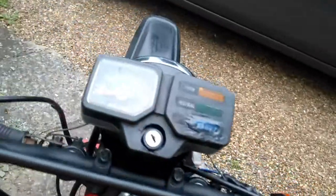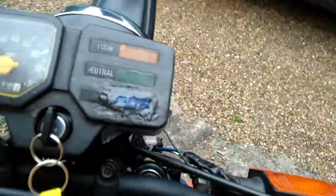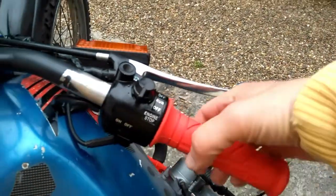We're going to have a go at cold starting. This is totally cold now. First I'm going to put the tank on reserve because that's all I've got — a little bit of reserve. Give it some choke. I've got a key as well, put the key in. It doesn't say neutral — that's a bugger, but it is in neutral. I'll give this half a dozen kicks.